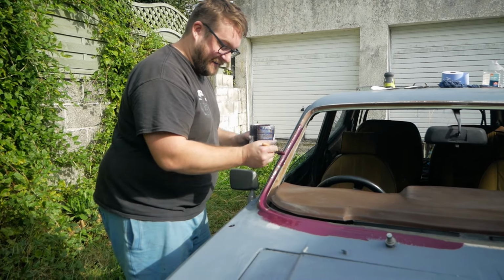We tried putting the seal fitting to the glass and then putting that as one into the car, hopefully pulling the rope around it and it popping into place magically. Turns out it's not as easy as it looks, of course, as everything ever. But more importantly, with the Scimitar in particular, the way that the clearances work on the dashboard and everything, with it in place, it's not possible, we don't think, at least with our limited experience. So what we're going to try now is putting the seal in the body first and then doing the rope thing with getting the glass in, where you've got more access to the glass than the actual seal going onto the body. That makes sense?